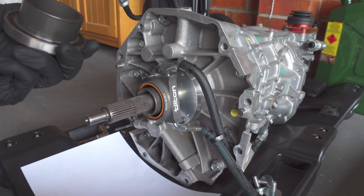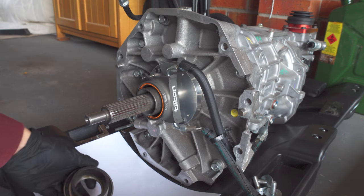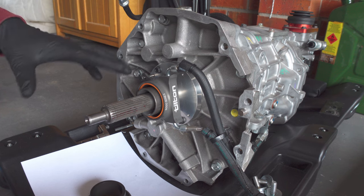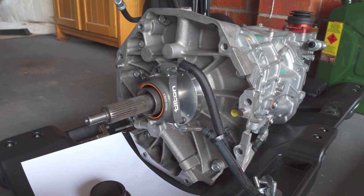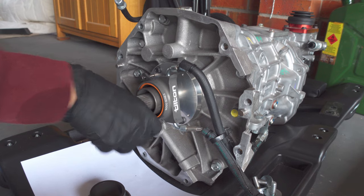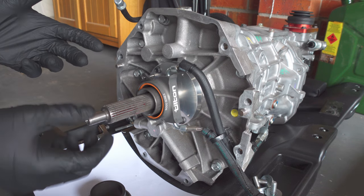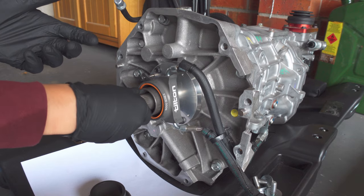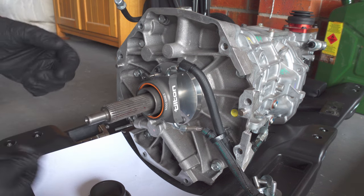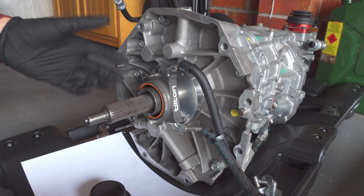Tilton have said that having it jammed when only pressed from one side is completely normal, because the clutch pressure plates are meant to press evenly around the face. So that leads me to think the clutch is still misaligned - even though I've checked the bolts and they are still torqued, I'm going to recheck them all again and maybe get a flat bar to see if it looks parallel with the face of the gearbox or bell housing. Also, it's quite a noisy gearbox and the reason for that is slop between the gears. JZ engines are notorious for having quite a bit of vibration at low RPM which rattles the gearbox - completely normal, nothing to worry about.